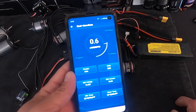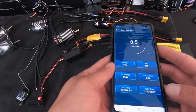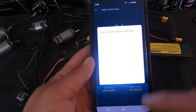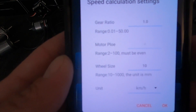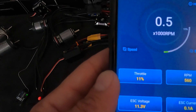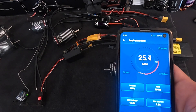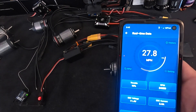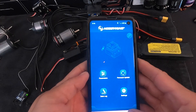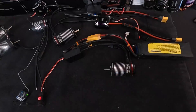If you go out of Bluetooth range, the motor stays operational — it'll just disconnect and not really care. You can also enter your tire size information, and it will display output in miles per hour, giving you a speedometer on your truck. If you calculate everything correctly you'll get accurate speed readings. When you're done, just disconnect from the ESC and close the program.